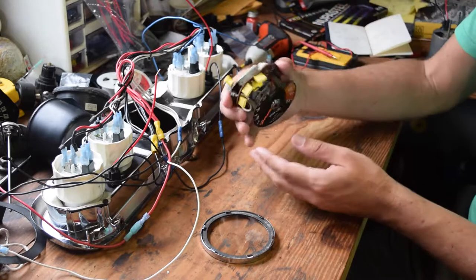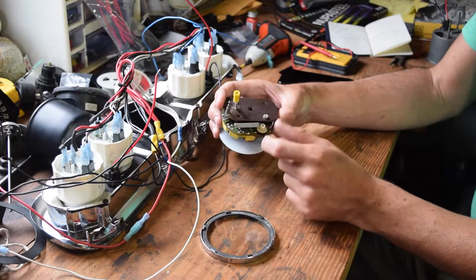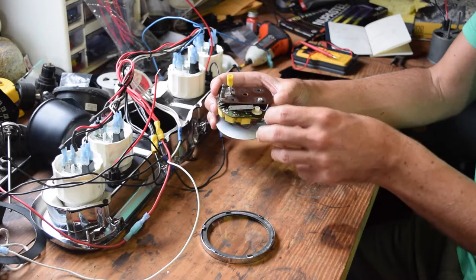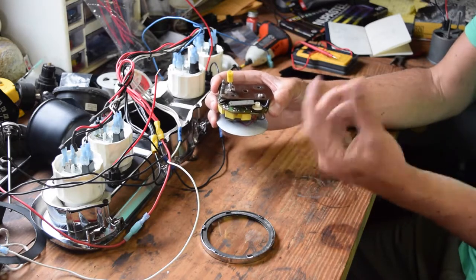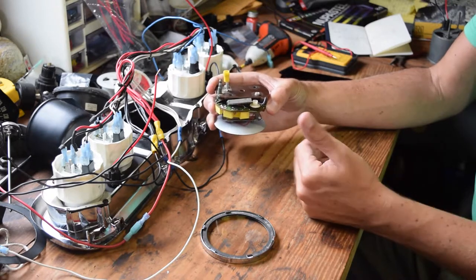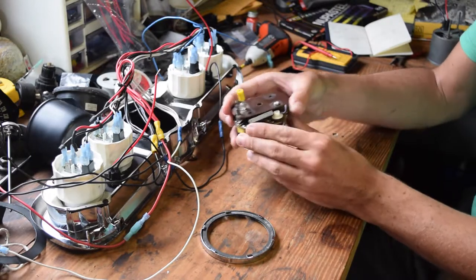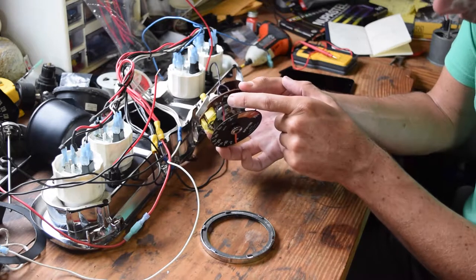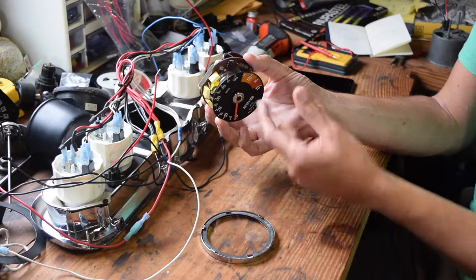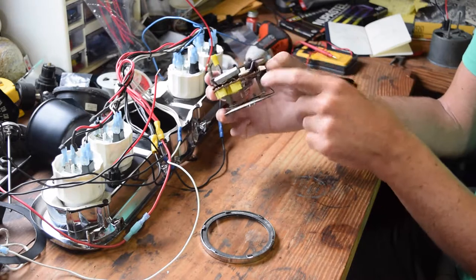So on the inside, what we've done is we've added a potentiometer, which you've probably seen on a guitar amplifier, any knob that you can turn and change volume or bass or treble or whatever. That's a potentiometer that basically varies the resistance in the circuit and it changes the output, right? Actually, what I've done here is, you probably can't see it, but there's a little integrated circuit here, which translates what's coming from the engine and converts it to basically magnetic output, which is how the coils inside this tach work.